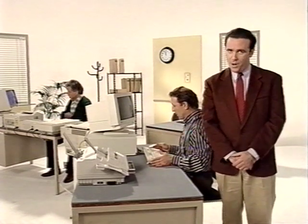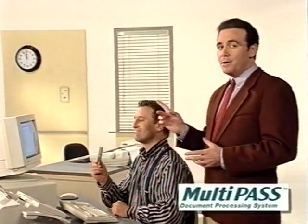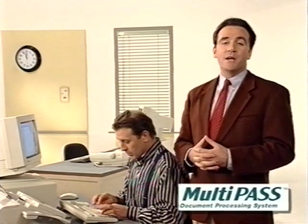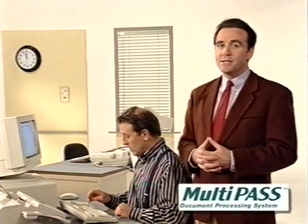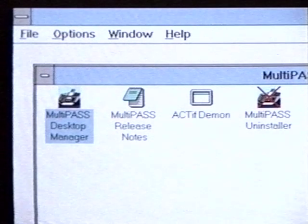All you need is a PC that works with Windows 3.1. You simply plug in the cable between the B360 and the PC, then hook it up to the telephone plug, and put the other plug into the socket. You put the Canon diskette into your computer and type setup. After the software program is copied automatically to your hard disk, icons appear on your screen. If you select one of these icons, the B360 is ready to fulfill that specific function.